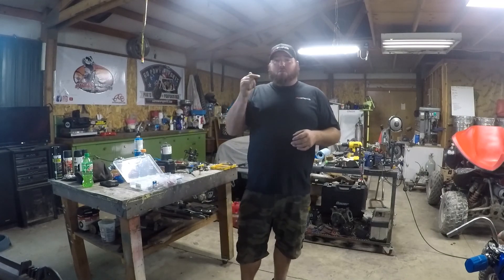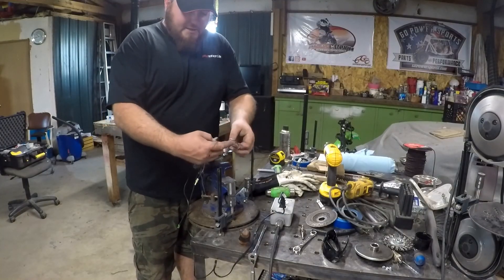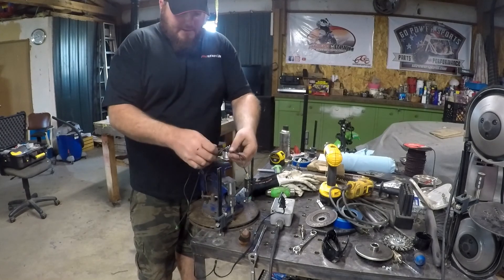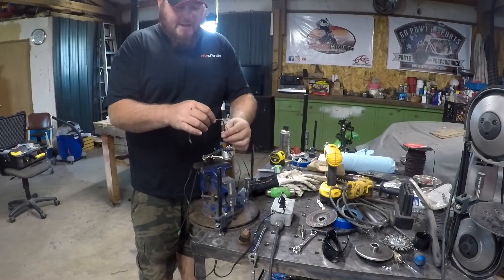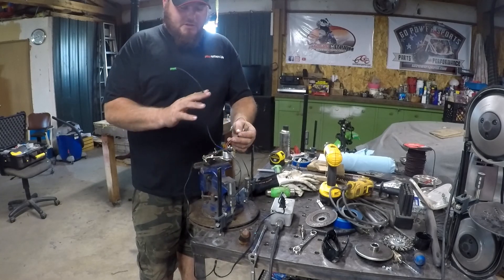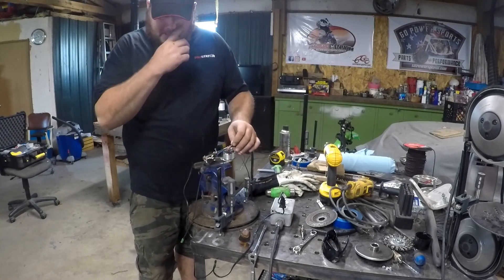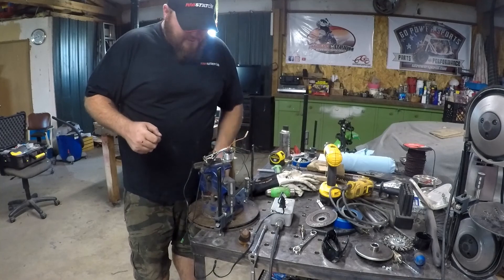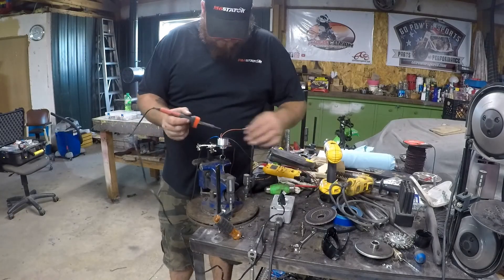Let's get into wiring up the ignition. The back of this is actually pretty easy. You've got the ground side and you've got the power side - this is your power from the battery and from the charging coils. This goes to the starter. It's fairly easy, but we've got one too many grounds and I don't like just snipping stuff off, so we're going to go ahead and desolder this right now.